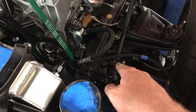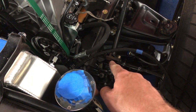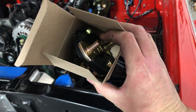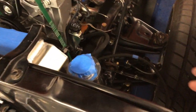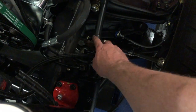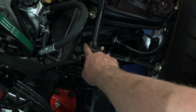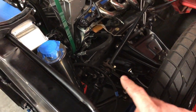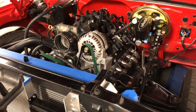Eagle-eyed viewers may have noticed that the original 1972 rag joint is still in there. I went and bought a Mains 201 coupler — about 10 bucks — to replace it. Everything else in the steering is new, and when I was watching it turn, the safety pin was contacting each side, so there's a little bit of slop in it. I'm going to swap that out.